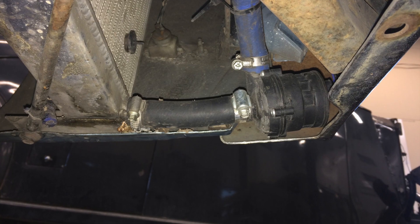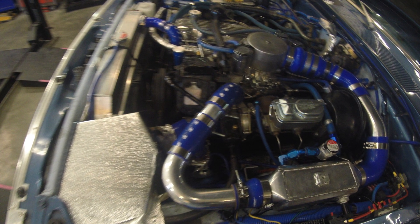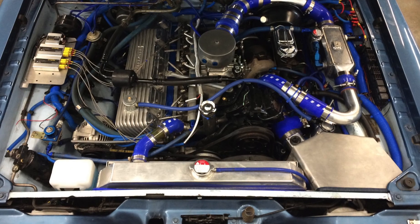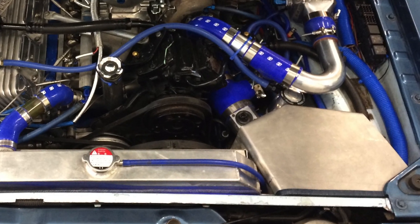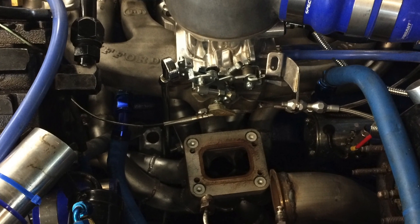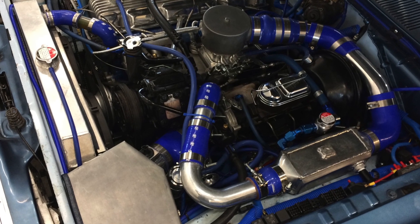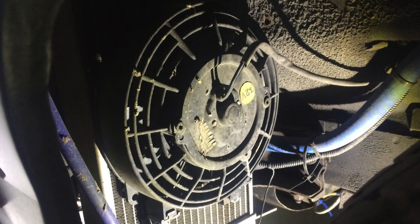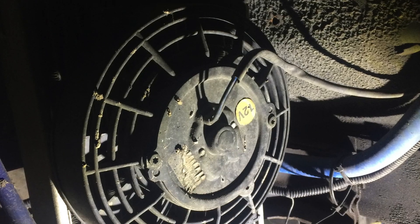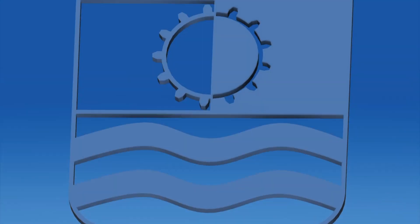That pump circulates coolant through the intake manifold first and then through the intercooler on the fender. All that's tied into the Haltech ECU, which is looking at the intake air temperature at the air filter and what the air temperature is inside the intake manifold. From that it decides how much to run the electric pump, and there's also an electric fan on that go-kart radiator to keep it as cool as possible. Thanks for watching.